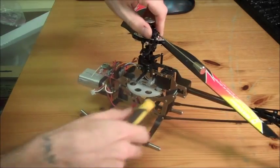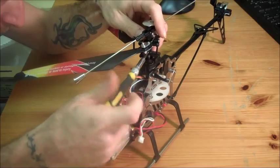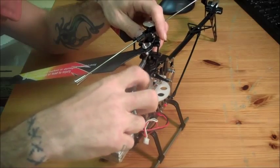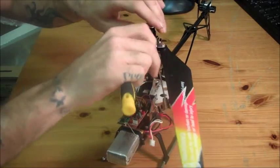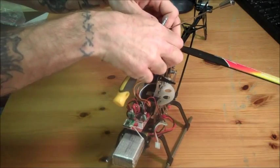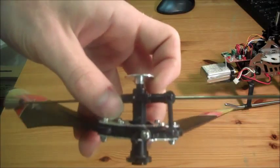In order to do this, you're going to take your helicopter right here. We've got one set screw right above the swash plate right here — go ahead and remove that one screw and set it to the side so you don't lose it. You're going to want to pull your linkage off right here on both sides. A thumbnail works really well if you have it. What you're left with is your main blade assembly and your balance bar.